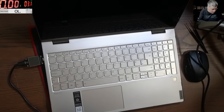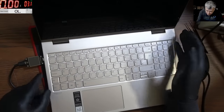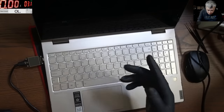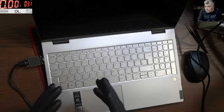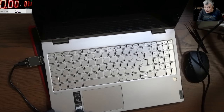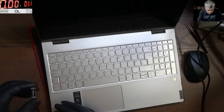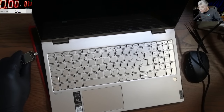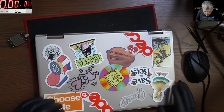I did see a picture briefly when I pressed the power button — just one or two seconds of image on screen. That's strange, because on these laptops the IO chip is controlling the charging and communicating with the charging management chip, or the power management chip. So let's open this laptop quickly.